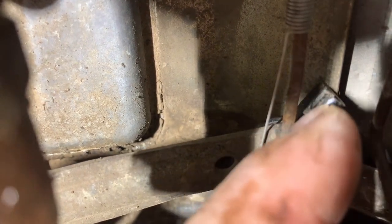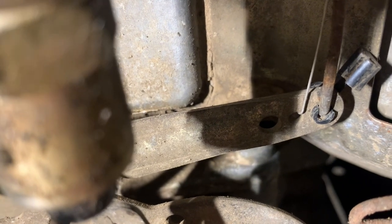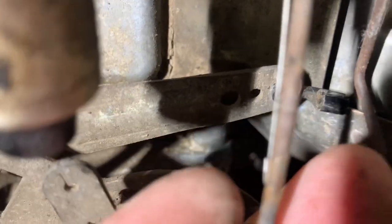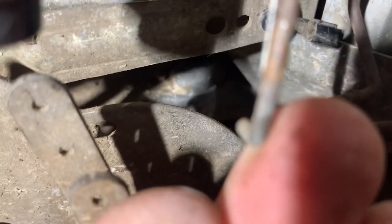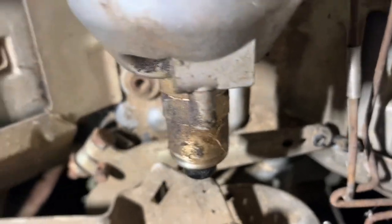Right here there's a little slot, and when you go to put it back on, we'll just slide it up and push it. We also have a little tiny spring next to it. Just go in with the needle nose and pull it down a little bit. I released it from that little hole and it's just sitting up there next to the other one. It's a metal piece. The plastic piece that we unsnapped it from just lays there in that hole. Once we reinstall, that just slides back in the hole and the plastic slides back up over it. Now we at least have the throttle control.